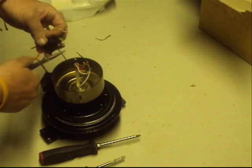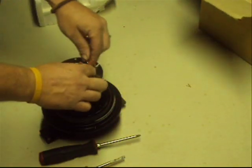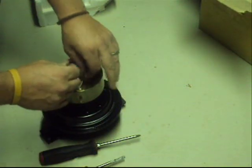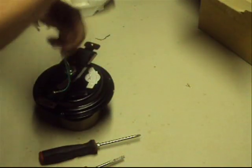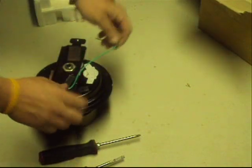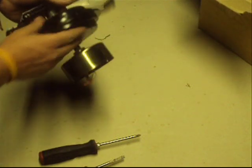Right up here on this switch, you want to cut the wire as long as you can. There we go — the capacitor and multi-speed switch. Those wires there are the ones going into the coils. On this side we have the rubber band. These three wires — goodbye; these are the ones going to the lamp, we don't need them. We're left with this ground wire and this spring clamp right here, and we've got to take everything else off so we have nothing but those.